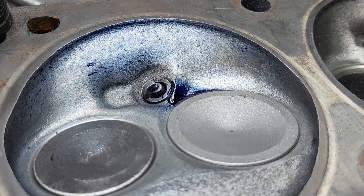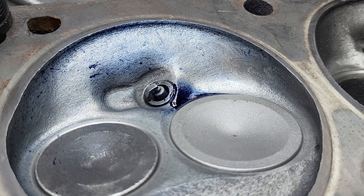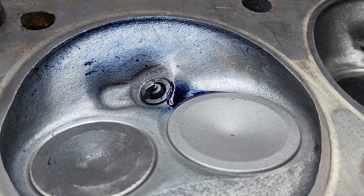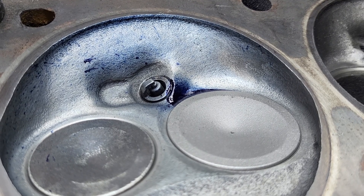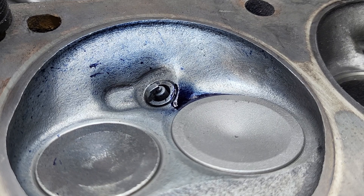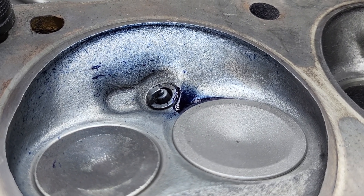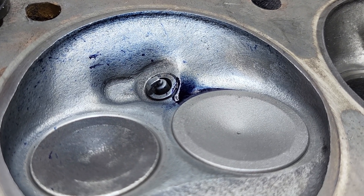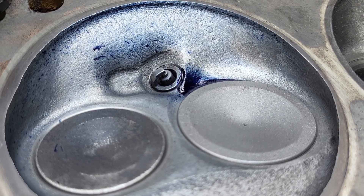Okay guys, rounding down to the end of the Mission Impossible, trying to squeak a few CFM here and there. Now I actually did two flow tests. The first one was I gave our pushrod pinch curved wall a little stoning action and we took a look at what that did to our flows, our swirl, and our airspeeds — very interesting stuff.